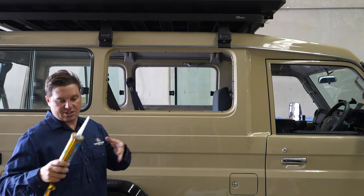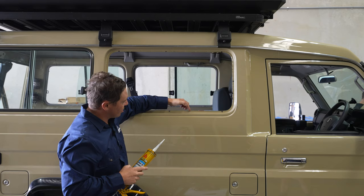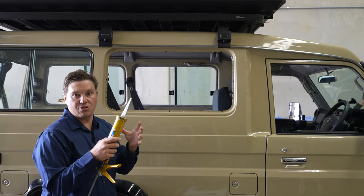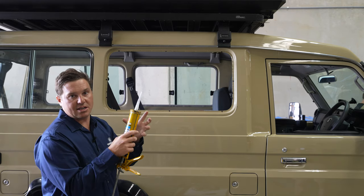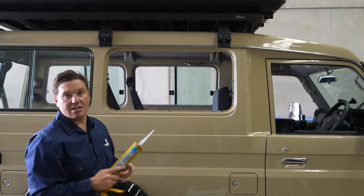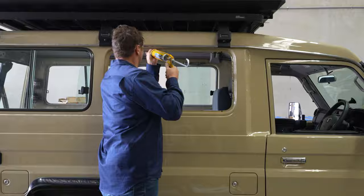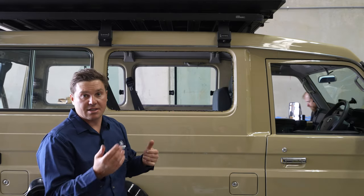We've got some black silicon. It doesn't actually need to glue the gullwing in because the front fascia and back plate are sandwiching around the sill — this is just a sealant. We're going to run it quite close to the top edge, near the opening, the whole way around. We do seal on the inside too, but this just allows a seal between the two so that as water tracks it doesn't get in anywhere. Small bead the whole way around, then we'll pick up the gullwing and place it in gently. The less silicon you have to wipe off later the neater it ends up.